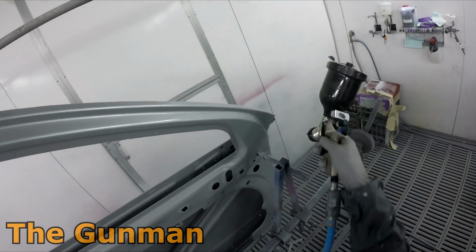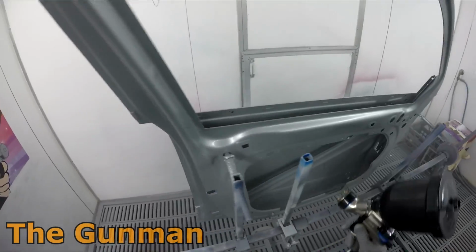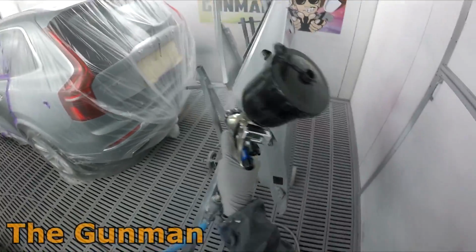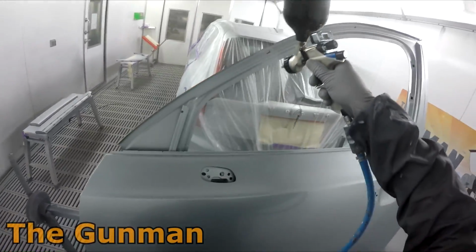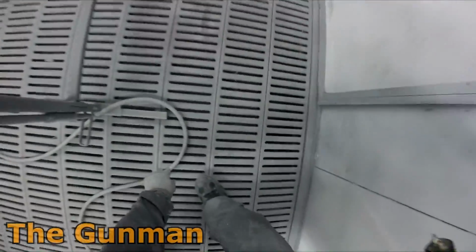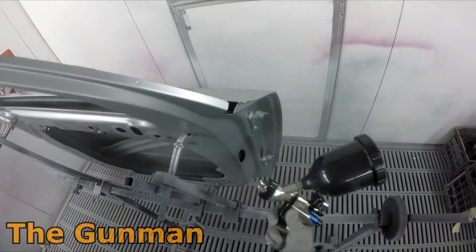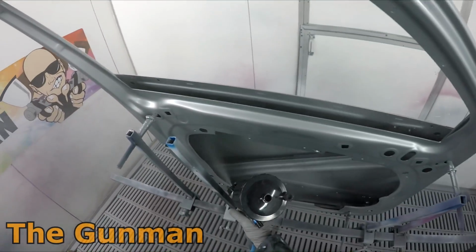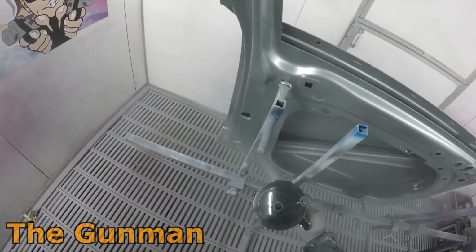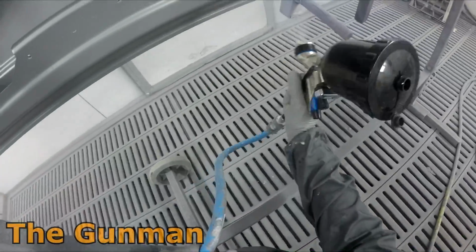I have mentioned it in a few other videos, but you may not have seen them, so I'll mention it again. From my experience, and it's actually an email that Spray Guns Direct forwarded to me from DeVilbiss themselves, if you get a gauge down the bottom of your spray gun, where most of us usually put your analog cheater valve gauge, it will read, say, 2 bar down the bottom, but up the top on this digital gauge it'll read 1.5 bars. So just keep that in mind when you are setting the pressure on your DV1. You don't really want to spray the DV1 digital at what says 2 bar on the digital gauge, because you'll be essentially running it at like 2.5 bars, so massively over pressure.